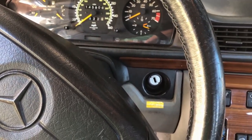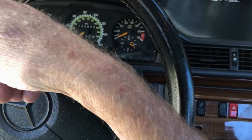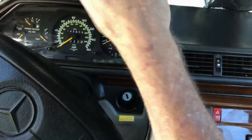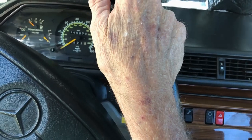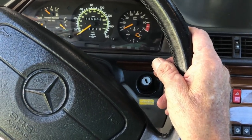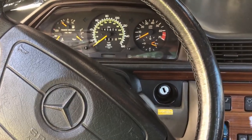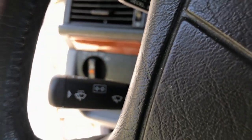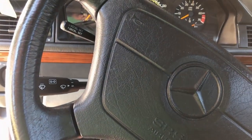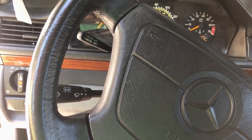Before, I don't know, three videos ago, I was having a problem where the high beam flashers were not up. One high beam light was out. One fog light was out, but all the bulbs were good. So I traced the power a little bit, and I said, you know what? It's the light switch and the combination switch. And after 30 years of using those things all day long, they get worn out. So I highly recommend, this is a Euro product, and I'll put a link where you can get these. I'll give it a shot tonight, drive it around,